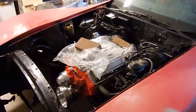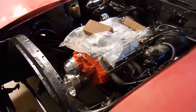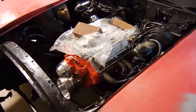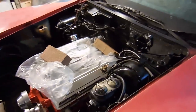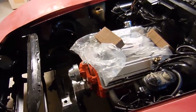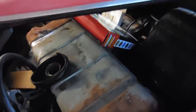There's a lot of things that need to happen before that. We need to put the headers on - start from the bottom. Put oil in it, bolt the headers back up, make sure the intake was put on correctly, make sure the valve covers are good, put on the carburetor, put on the serpentine belt system, put on the radiator, plumb everything up, put in the distributor, get it to have spark, have fuel, put in the gas tank - all that kind of stuff in order to make the engine run again.